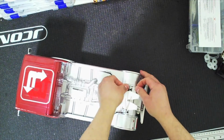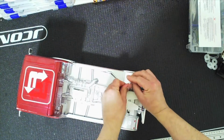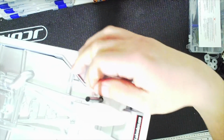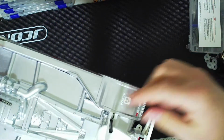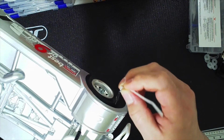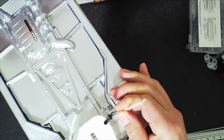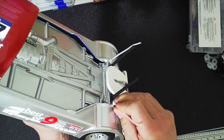And you're just going to push it through the body clip, and pull on this, and the reason why is once you strap this and you start to pull, before you trim it, see, it's going to be pointing up. Now, you can always flip the body clip, that's fine. But the reason why you want to have these is so that you can easily remove them. I mean, you could attach a piece of string or a piece of wire, but a tie strap just lasts longer. But this is just easy. It's just a lot easier to pull on the body clips.